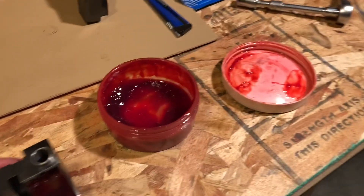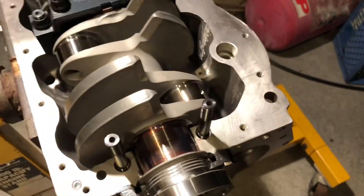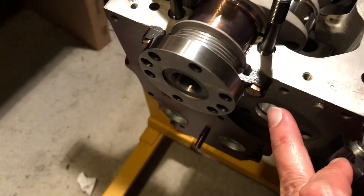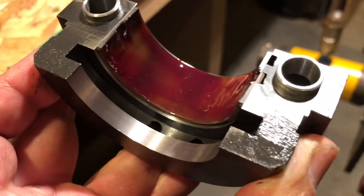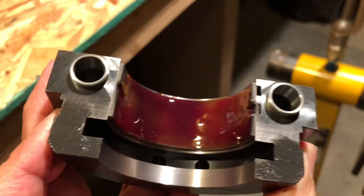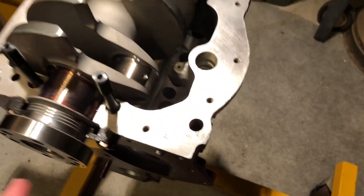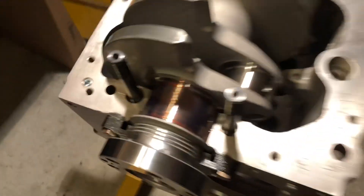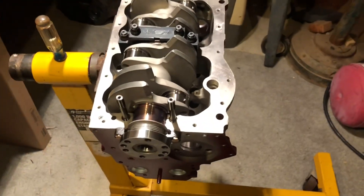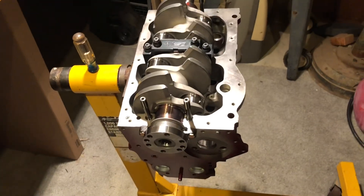One of my favorite topics. I like the original setup. Here's how you set them up: once you're sure that piece is flush with the block, a little bit of black silicone, a layer painted on with fingertip as you assemble it to the main bearing cap. If everything is put together correctly, it's been line bored in place, you leave no gap here or here. We make sure of that with our little dabs of RTV. This will work - it will not leak. You don't need a rubber seal dragging on the big wide flange of the crank right here. This setup works.